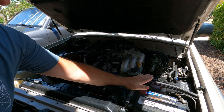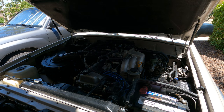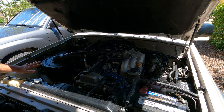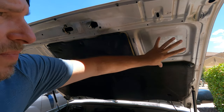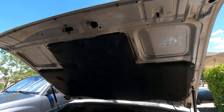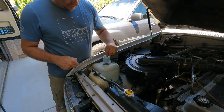Let me get set up, get the hood open. Here in the '97 is where the battery sits. You can see the same style battery box over here was on the early cars like '91-'92. I'm going to take this washer fluid bottle and relocate it back to this empty area, and then that battery box should sit right here and the electronics mount goes somewhere right in there. You can see the cutout in the hood from the early years where the second battery box was — it's kind of cool to put them both in. I don't know if I'll run a dual battery setup or not, but I want to set it up because it's a lot of wasted space on that side.